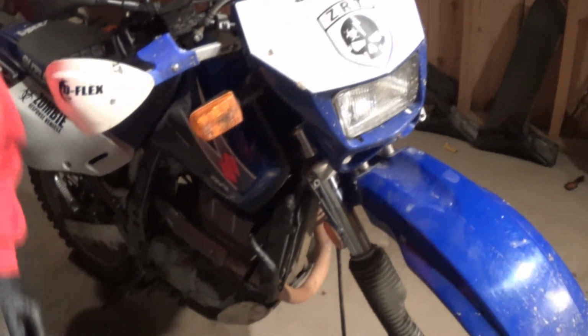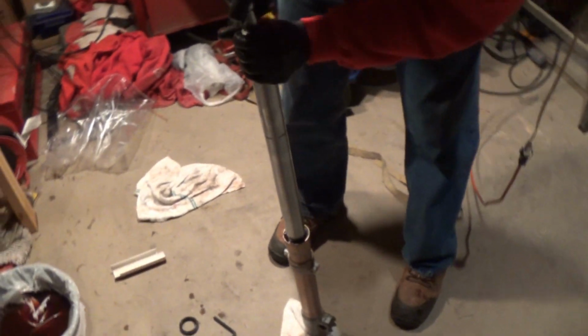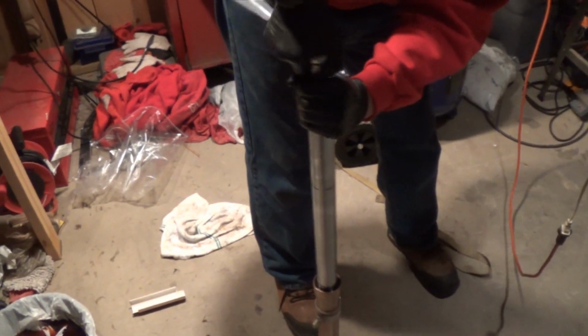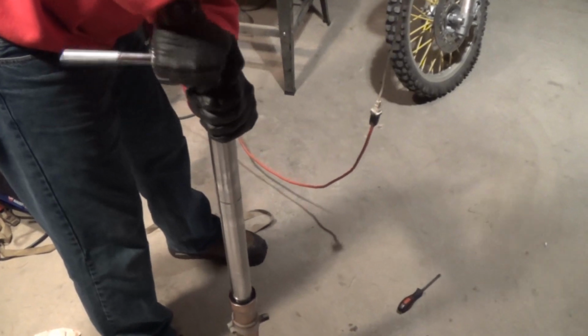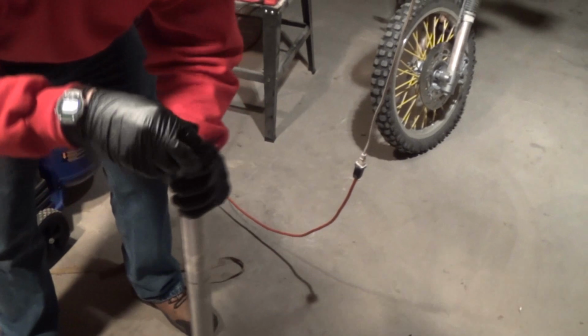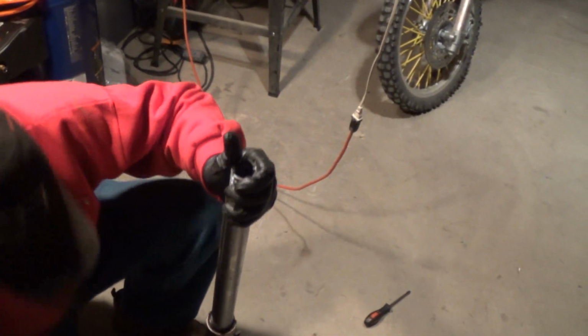Alright, I'm going to cut to where we're actually taking it apart. So take this cap off, and I usually keep my hand over it because it's under pressure. You don't want it hitting you in the face, the spring or the cap. Yeah, both of those. There we go. So, cap, spacer, washer, and the spring.